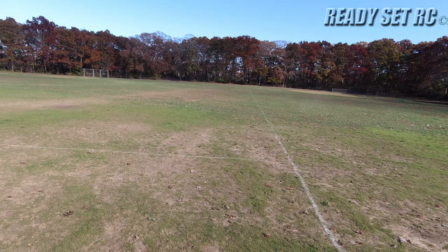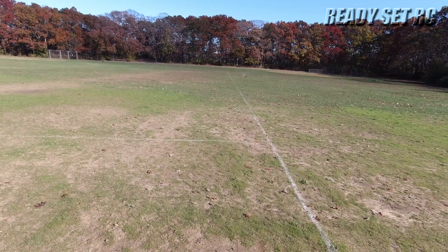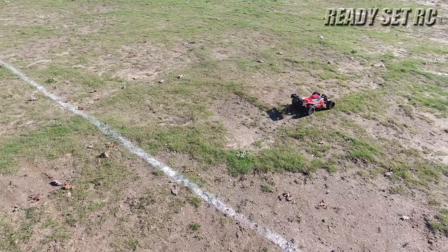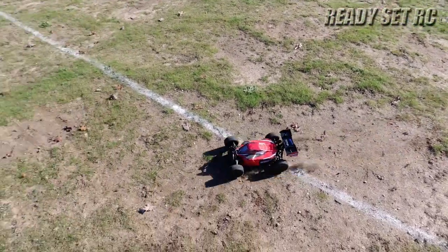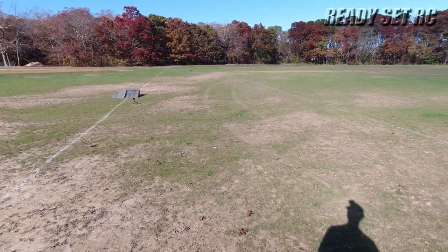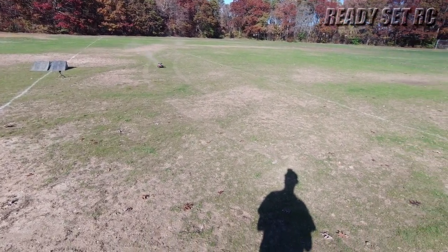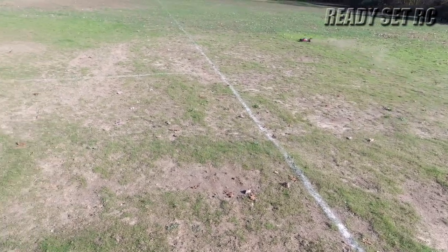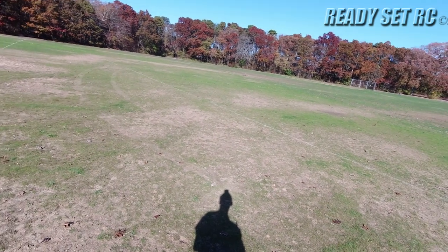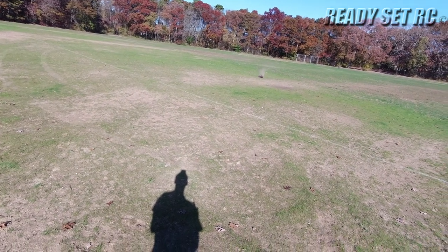And it tends to spin out just as I'm trying to get on throttle. You gotta ease into it with these tires. See, like that? Yeah, the back is gonna get away from you if you try to get on the throttle for even half. And that could be a little bit of tuning of the diffs, but I'll be honest with you, I never had to tune the diffs when I was running the stock tires, so I'm gonna say it's the tires on this.